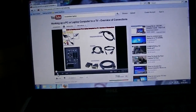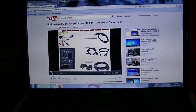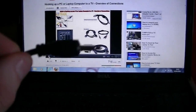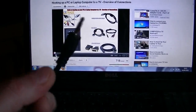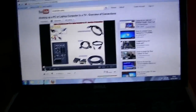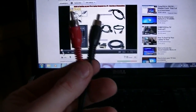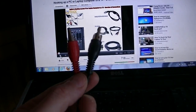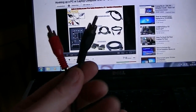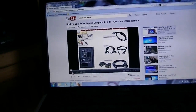The second cable we need is an adapter cable that adapts a 3.5mm audio jack to an RCA. This is what the 3.5mm connection looks like and it will go into any standard sound card on a PC or laptop. The other end looks something like this — it may be red and white, which would be the traditional one, but the one I've grabbed here is red and black. Red will go to red, white will go to white, but in this case the black would go to white as regards the audio in your sound system. So those are the two types of cables we need.